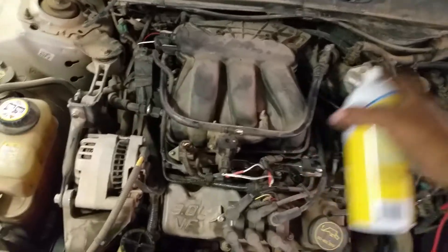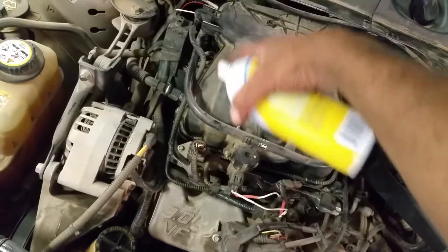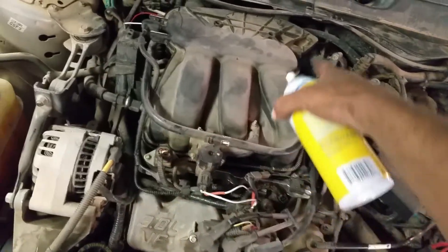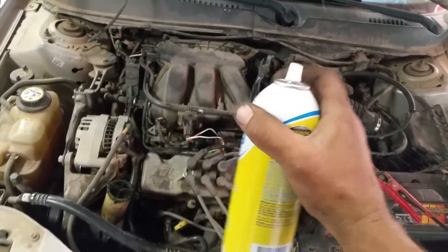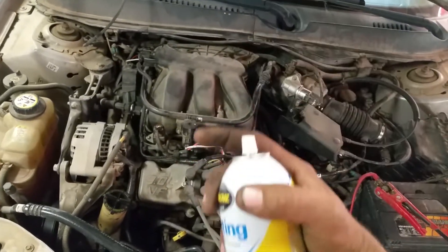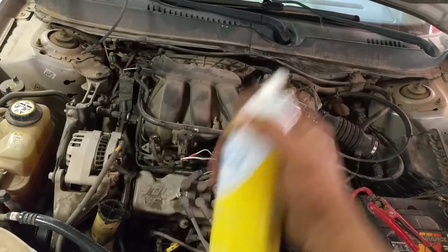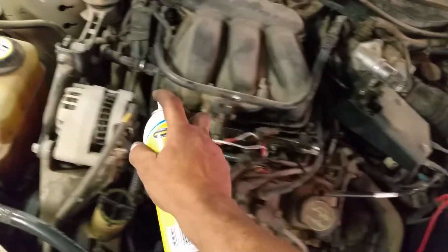What I'm going to do is check around the intake, check all vacuum lines, and check the air intake where that comes in. This is our intake right on top of the engine — we're going to spray around that to see if there's any leaks. We're going to spray the air intake and check vacuum lines. What this will do is like spraying starting fluid right into the intake if there's a vacuum leak, because it's sucking air. It will suck this right into the intake and your idle will go up — you'll hear an advance in the idle.